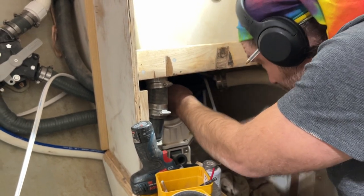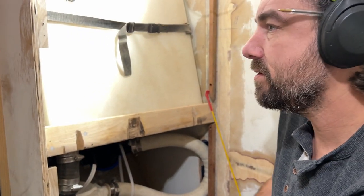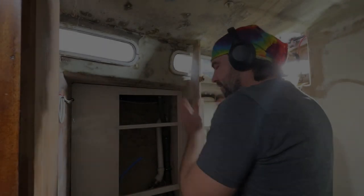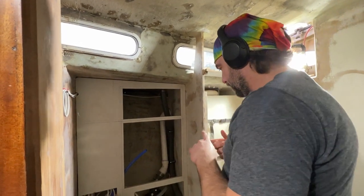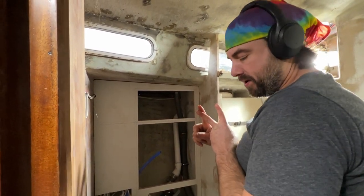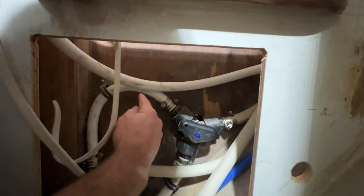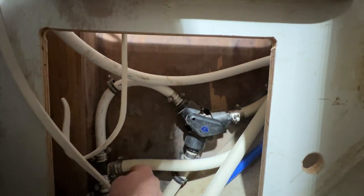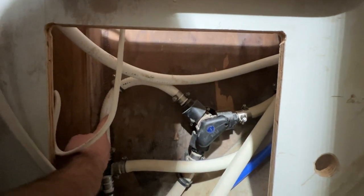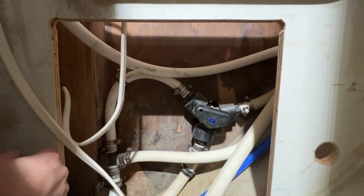So you've got all your plumbing run and now you're on to electrical? I have 90% of my plumbing run — the only thing I don't have is the rough-in hot and cold up here, everything else is in. We have two sources of water: the ocean and the freshwater tank. They are controlled by this Y valve. If we go like this, it's coming from here and going up to the toilet. If it's coming like this, it's coming from down there and going up to the toilet. This one is from the tank, this one is from the ocean. So hopefully we'll mostly keep it flushing with fresh water.